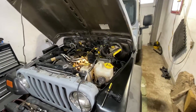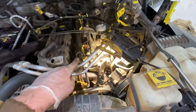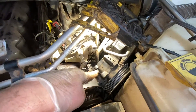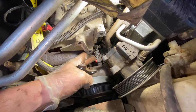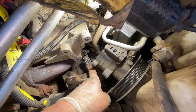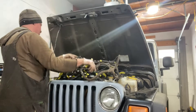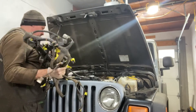I also have to show you this — there's a wire on top of the fuel rail. One wire goes down to the oxygen sensor and another one goes to a spot that required me to remove the power steering pump to access the plug — that took 45 minutes to figure out. But now I'm getting this off and the harness is coming out. I think I've got it — you could do the whole thing in a day to get it out.